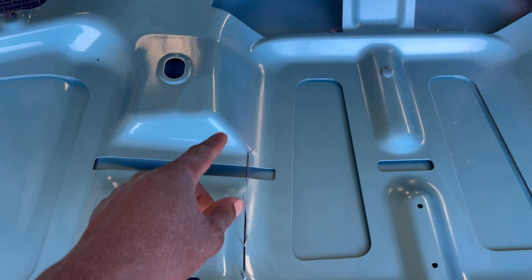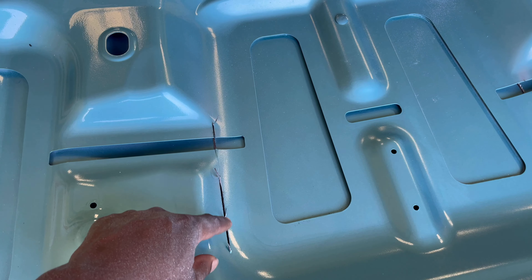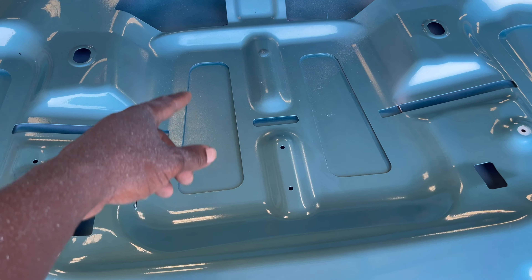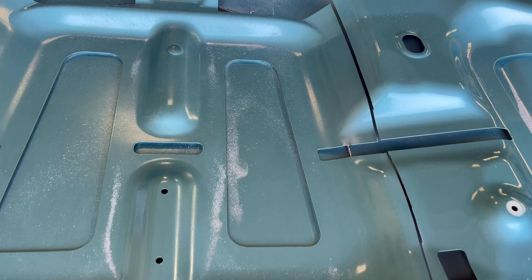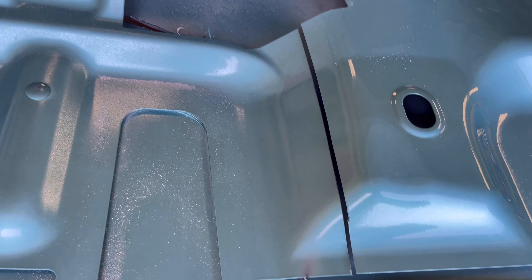Got the hood flipped over. When you're cutting this bracket out, you want to cut beyond the cut you made on the top, so that way when you're looking down at the hood from the top, you don't see any of the brackets. So you're going to cut back some, like right around here. When you're cutting back, make sure you ain't got the blade too far down so you ain't cutting through the hood.